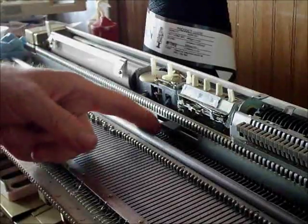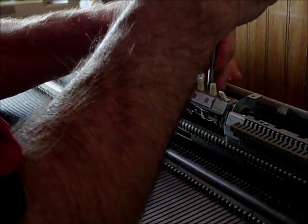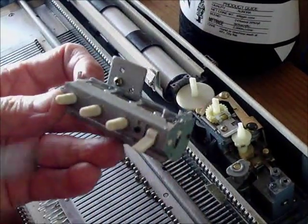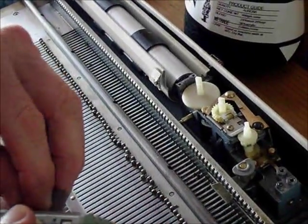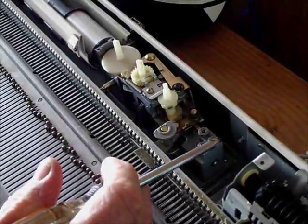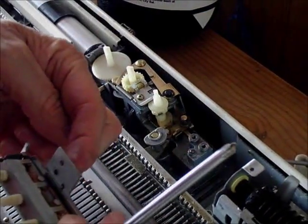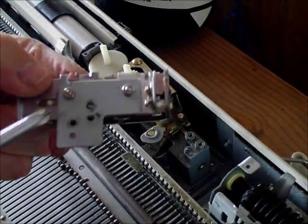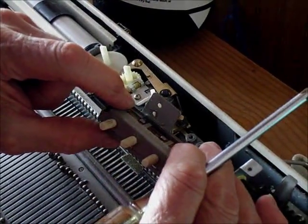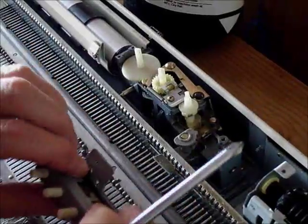The problem we're looking for is this flipper — that's the row counter. Now I'm going to get this row counter out of the way. There's a screw right in the back just to the left of that center pocket. When you look down, you're going to see the screw and two holes making a little triangular area. Here's the caution: you've got three holes here — this is threaded, this is threaded, this is a retention boss. If you're not careful, you'll think that little boss goes in one of these holes. It does not — it goes in this hole. So you have two positions for the boss and two positions for the screw, and you don't see that when you look down on it.